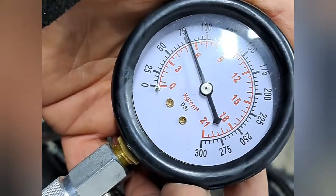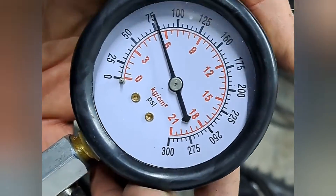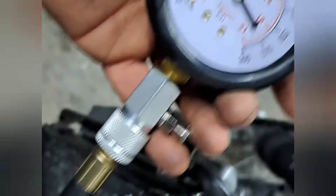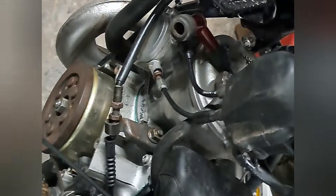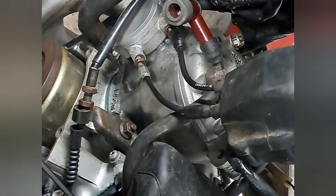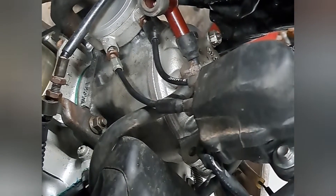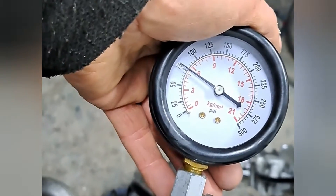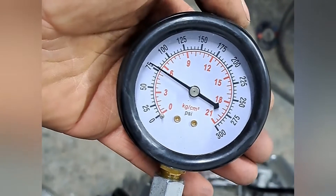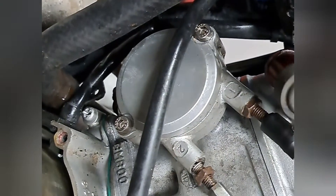We've got just over 75 PSI, and this is what I seem to be getting off all these engines rebuilt. This is at a full rebuild — it's a standard cylinder, standard rebored steel liner, and a standard piston. It's all freshly rebuilt: new piston, new rings, rebored to standard size. So 75 PSI just over — that's generally what you should be getting on the 3MB00 cylinder.